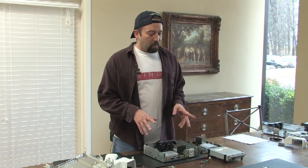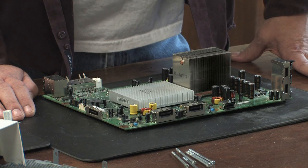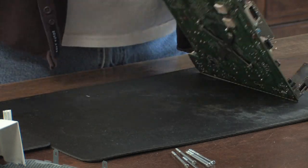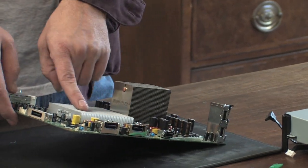There's only one fix I know of that works for the E74. You want to go through the steps to take your Xbox apart completely, down to the motherboard, and take the X-clamp off of the bottom of the GPU only, which is the short heat sink — the small one.